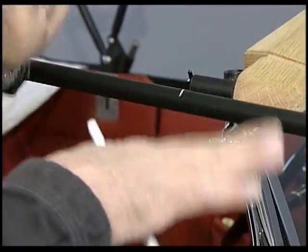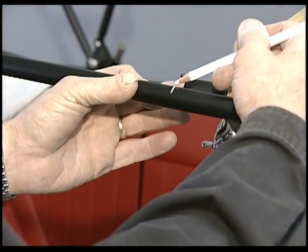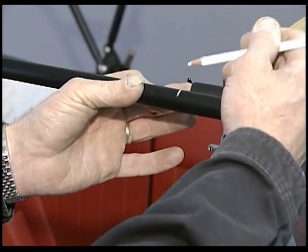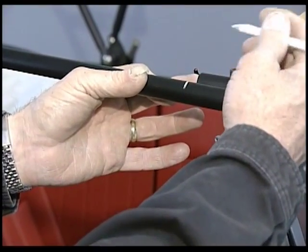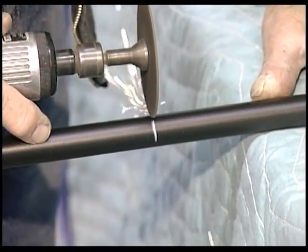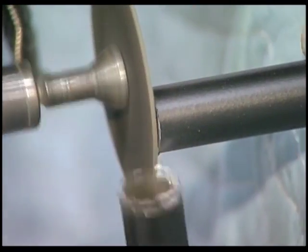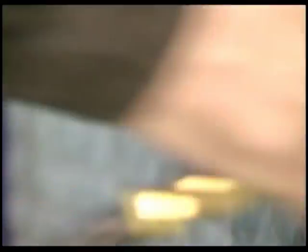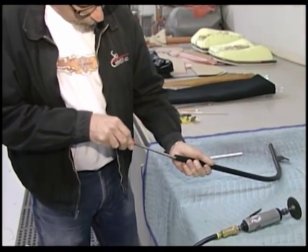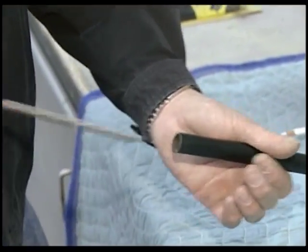With all that about the different arms and angle situations, we're going to get back to installing this arm on this car. You just line it up with the head piece and the arm and make a line here. Check it two or three times. Sometimes I'll cut it a little short and just sneak up on it. We've got this mark — we'll go over and cut it. We use a die grinder; guys have also used tubing cutters. Once you're sure you have the right length, get a little rat tail file and clean it up, deburr it so the Delrin bung will slide in there and mount to the head piece.